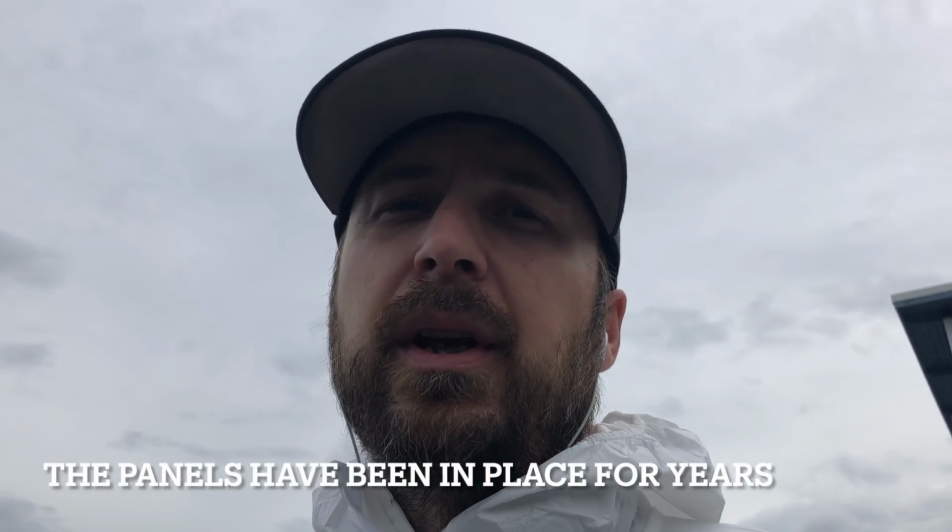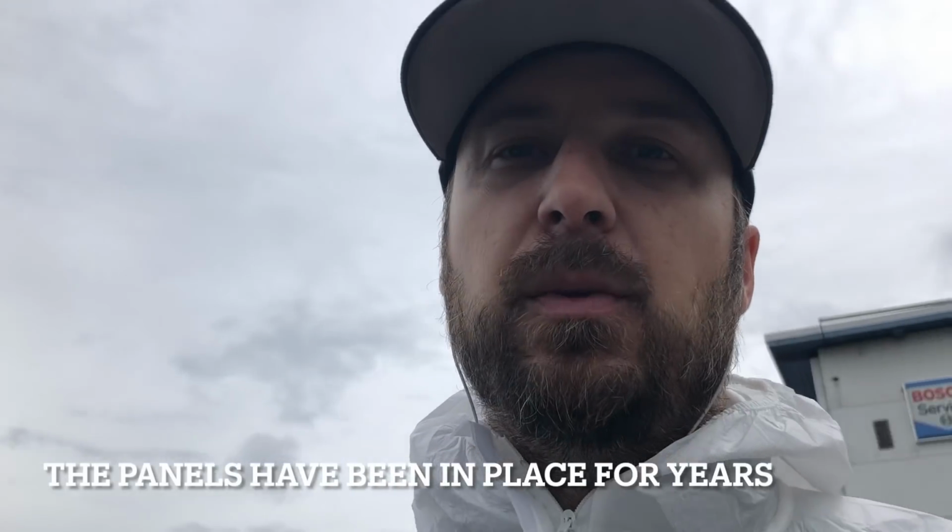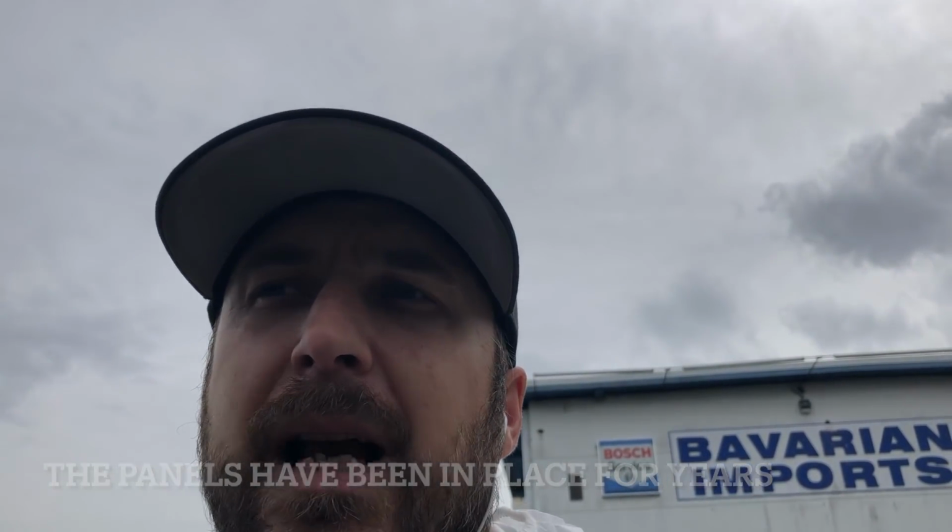And it sucks because we just finished more or less building this whole thing within the last few months or whatever. But I think the main reason for what's happening here is Jeff didn't have a heater for the longest time, and coming back over to the West Coast, a leak in the van and it going right down to the floor, that is going to just grow and grow and grow. Without that dry heater drying out that space every single time, that's what you're going to have. That's what happens. And he finally got the heater put in there. I forget who did the final heater. He wasn't actually in it that long, and then he had to go to the hospital and deal with what he had to deal with.